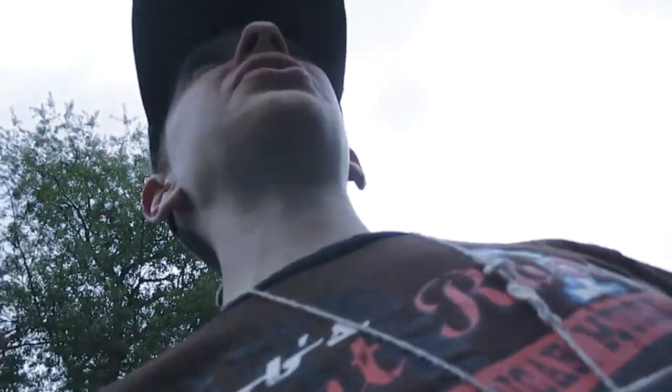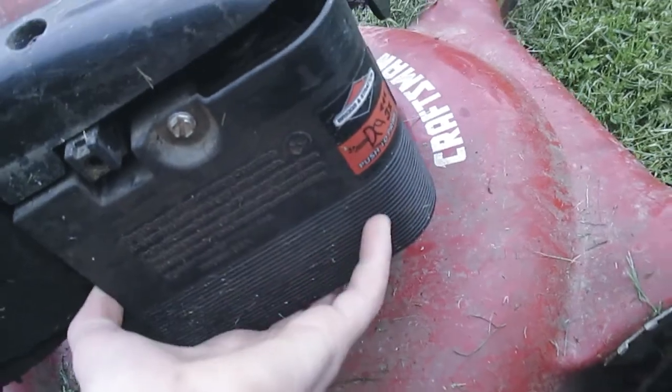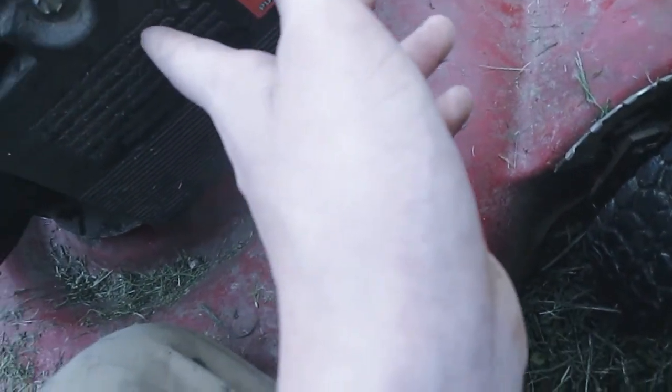Another hack that you can do is, even that really doesn't help that much if you put the cable down there. What you can do is take off this plate that's in front of the carburetor, and you take this thing off and you're right at the carburetor. You can access the carburetor really easily, and you could put a choke on it, you could put a filter on it, but you can squirt starting fluid into it so much easier.